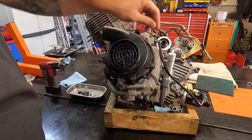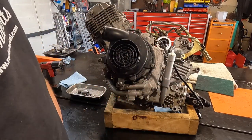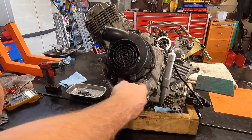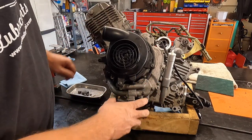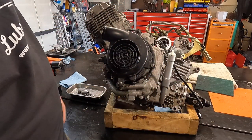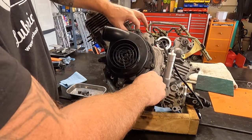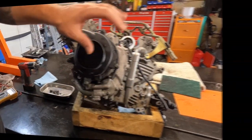Changing the stator is really easy outside of the unit, but a lot of times there are bars that block access and make it a pain — the water pump and all that has to come off too. We'll pull the hose line, take the water pump off since we're going to split the whole motor down in other parts of this series. We'll start with the fan case, the fan blade, the backing, and the water pump.